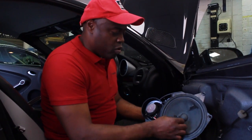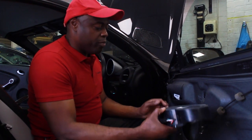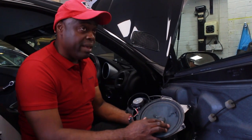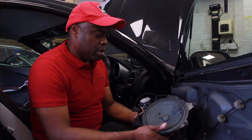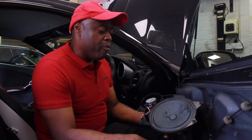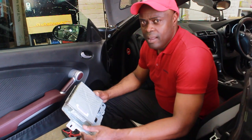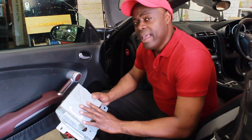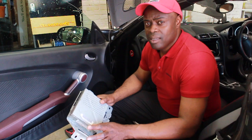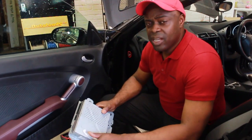On this occasion the voice coil had also gone inside — so not only had the cardboard perished but the voice coil had burnt out from inside as well. We're putting 8-inch Audison speakers in there, which will give us a better bass response. We've taken the original amplifier out of the vehicle and we're replacing it, which will give a much better sound — here's the Alpine 5-channel amplifier that replaces it, providing bass from the original location with replacement 8-inch door speakers, mid-range, and treble.